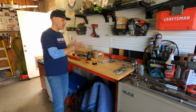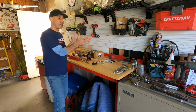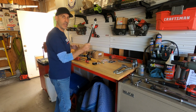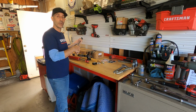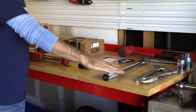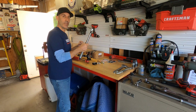Now, like I said in the intro, this is a very easy and high reward upgrade install for you guys. Now, the only reason I don't make this E for everyone and B for beginner is that you will need one specific tool. Now, I'm gonna use my heavy duty torque wrench because we're gonna be mounting into the track bar mount, and that's an important thing to get tight. And the instructions on this actually request that you get that to 150 foot-pounds, so getting that tool is unique to this. Like a standard 3/8 inch drive, I think this only goes up to 75 or 100 foot-pounds, so you're gonna have to break out that one tool to make sure you get your track bar tight.